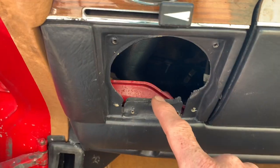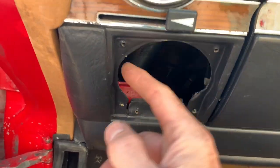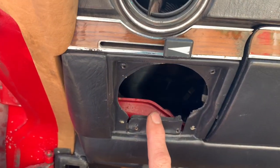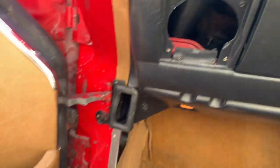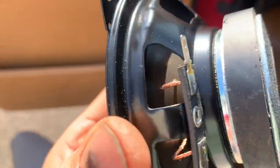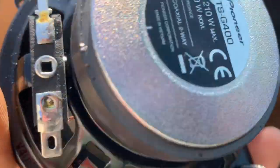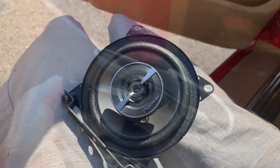Some people start cutting bits out to make it fit, but you don't need to. The plastic is pretty flexible — there's only a thin bit of wire there, and when you screw the speaker in it'll actually bend back on its own. The important thing is to mount these speakers so that the wire connections are on the side, not at the bottom or at the top.